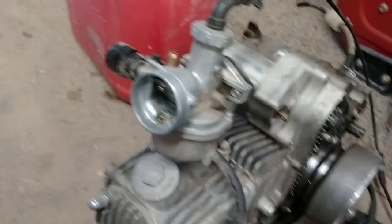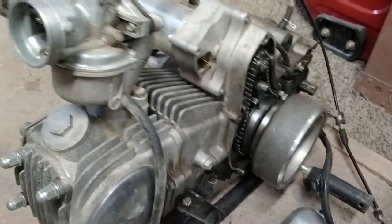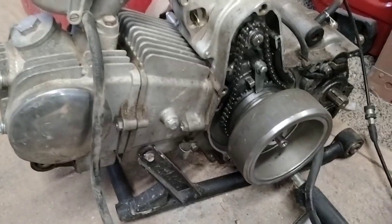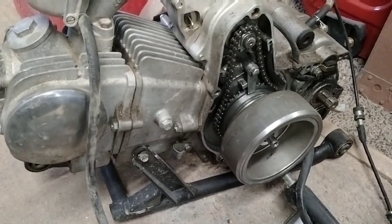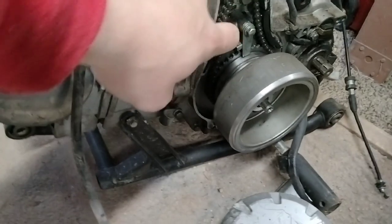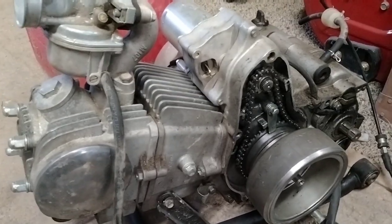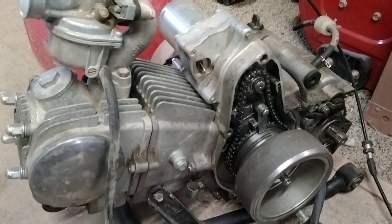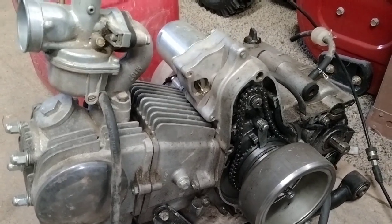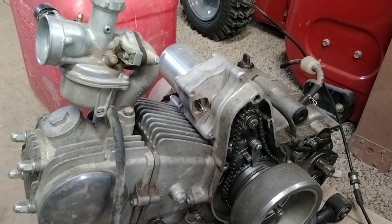We've got the engine over here. We started trying to fix this engine — there's actually nothing wrong with the engine, but there's some springs inside this clutch bell here on the backside. I couldn't get to them. I tried with the puller to get this clutch bell off, and no matter how hard I tried, it would not come off, so I can't fix those springs. The starter won't engage the actual motor to turn over — the starter turns over just fine, it turns and turns and turns, but it doesn't engage the clutch to actually kick the motor over. I've got another motor that Uncle Nate actually gave me, and I'm just going to give it back to him and put that motor in, because it started just fine in his tractor.